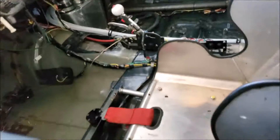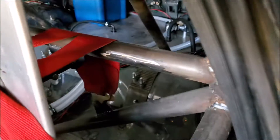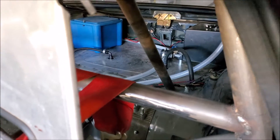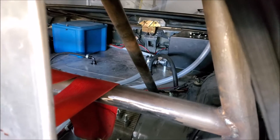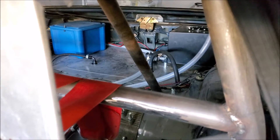The intercooler setup is now a hundred percent done. It's all plumbed, looking real nice, it's full of water, holding water, no issue. The only problem I had was that by forcing that hard plastic slash rubber hose over some dash-10 fittings — because the fittings were threaded and the hose is smooth on the inside — it was leaking. I basically just wrapped the threads with a little bit of black silicone and put the hose back on. That was the end of my leaks. It's got five gallons in the tank, holding fine, and the pump runs with no issues.